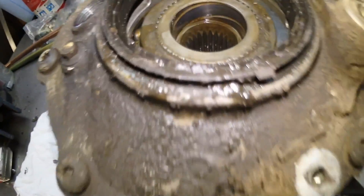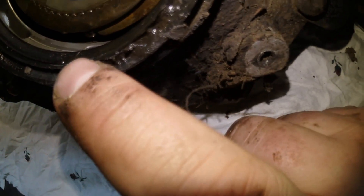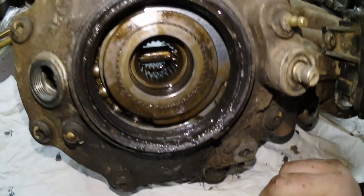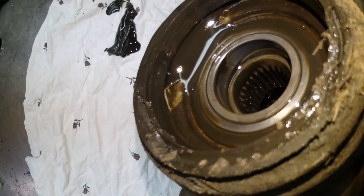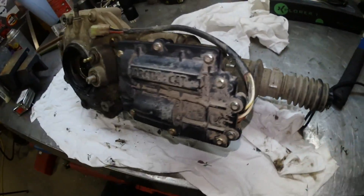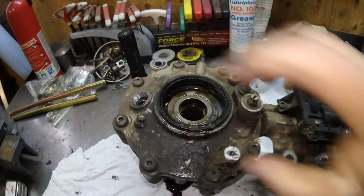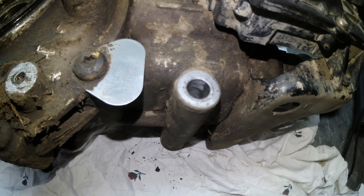Let's have a closer look before we strip it down in the next video. You can see there's mud and rust — you can see where the seal is a little deformed right there. The backside wasn't leaking, but look at all that mud in there. This is going to be nasty. I've got a complete bearing and seal kit. It looks like the differential splits in the back here, so we will have to remove this after all. Pull this cover off — the tag says 3.6, that must be the gear ratio.